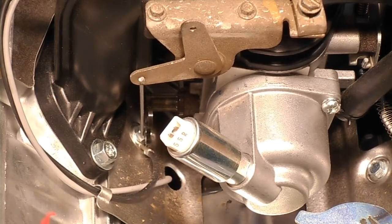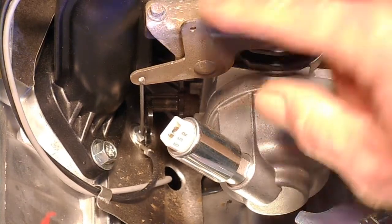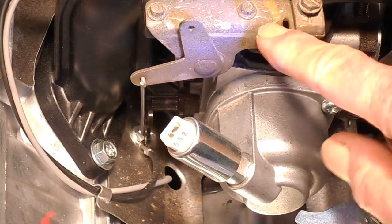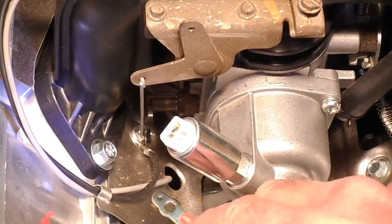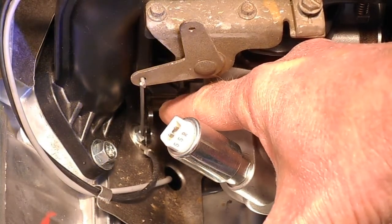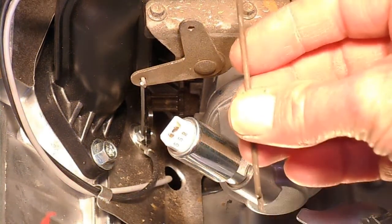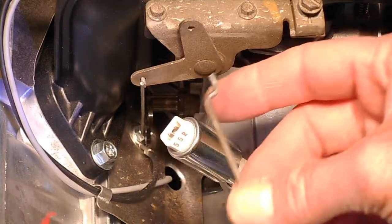So I had to come up with a way to defeat their system. What I finally figured out was I salvaged this piece off of the old motor — that's the bracket where the control cable came in. This piece clamps to the actual outer sheathing on the control cable, letting the wire come through and connect here. The trick was, instead of having this control rod coming up off of the throttle linkage hitting the choke control back here, I needed to get a control linkage to come from here and go straight back to that linkage. The problem I ran into was when I tried to use the piece that came with the old motor.